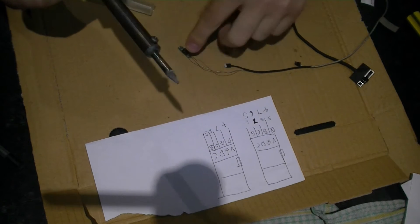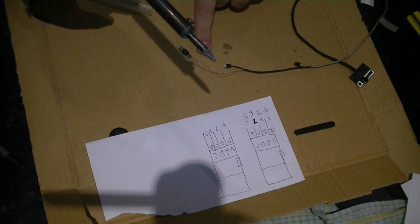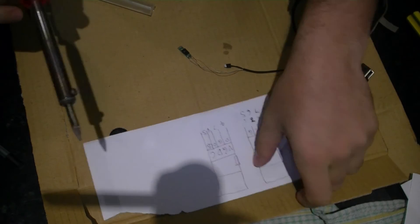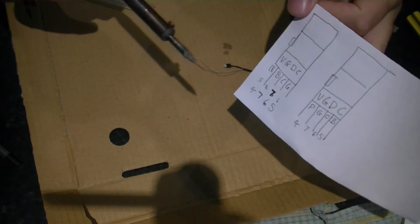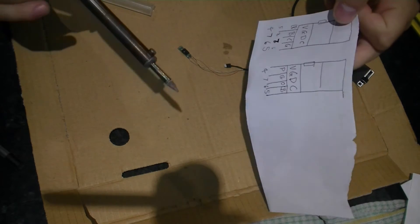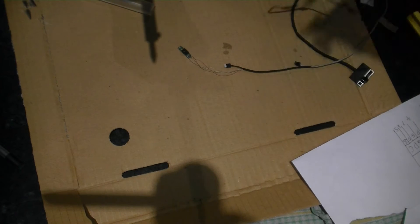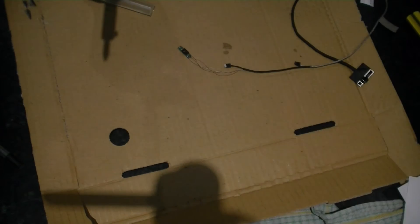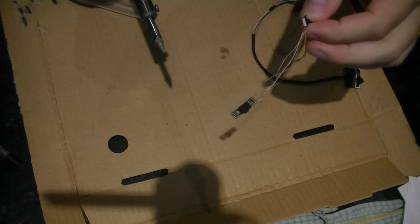When you get to the part with the LCD screen cable where you attach the wires to the little microphone, it can be a pain. In this case the new cable came with different wire coloring, so I had to work out each color. I went through all the pins and worked it out — there's VGDC labeled on the little board in tiny writing. I tested connections with a voltmeter from one end to another, working out each individual pin, which is time consuming — took me about 15 minutes. For soldering one of these on, you'll need some flux, good solder, and patience.